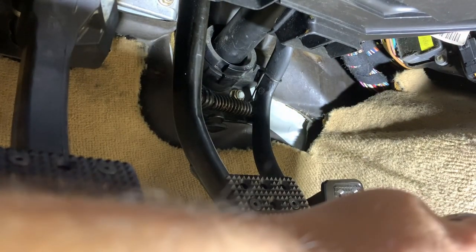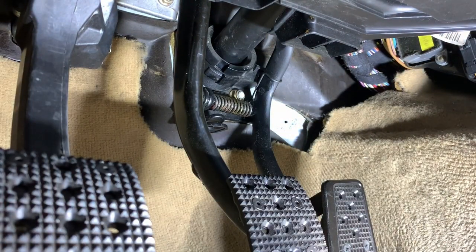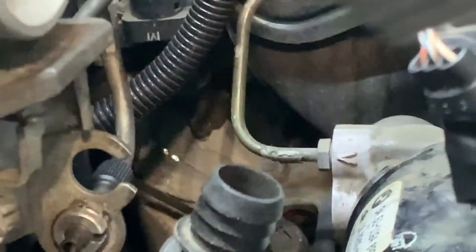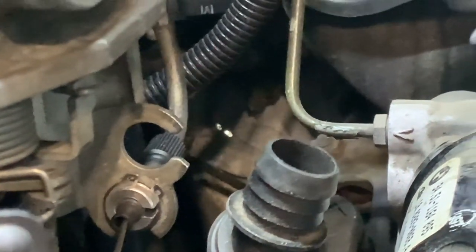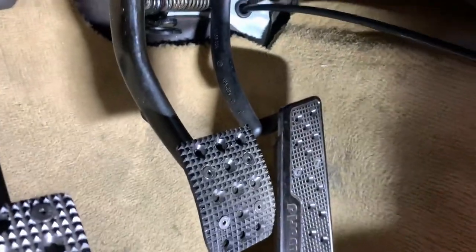I think I'm going to drill the hole right around here. I could probably go into the transmission tunnel but I'm going to have a line really close to my foot. This is going to be just a little pilot hole. If you go any more to the right than this there's a brake line right here — you can just see the little light. See it right there? That's the brake line. So I'm just going to drill that out more and that'll be our main line. Great success — the grommet fits perfect and I was able to just jam the line in there.